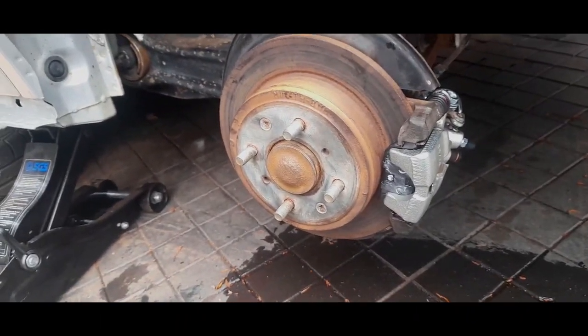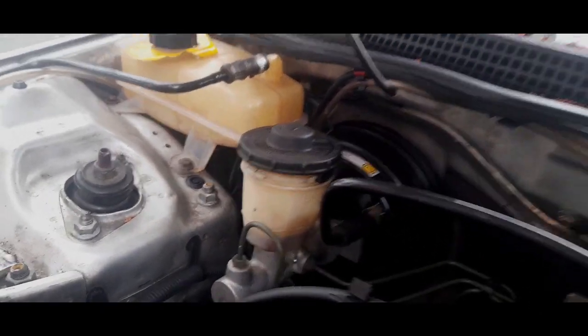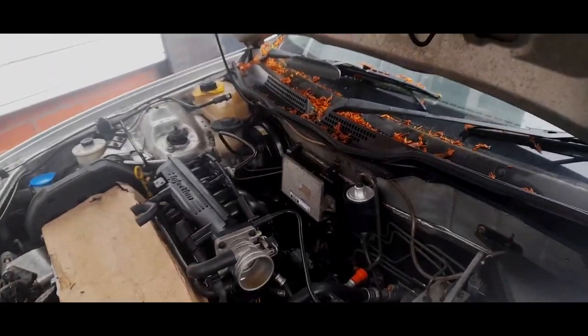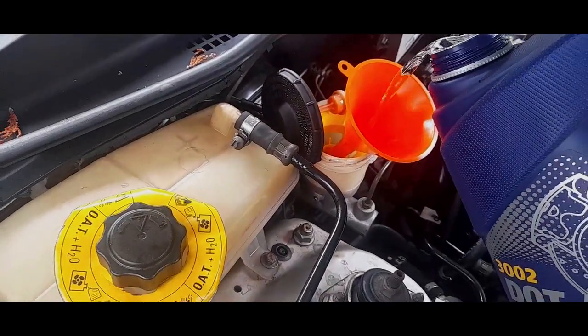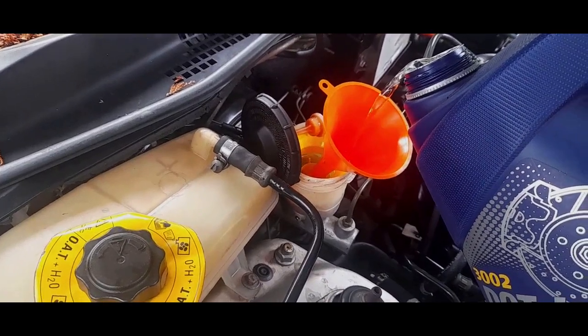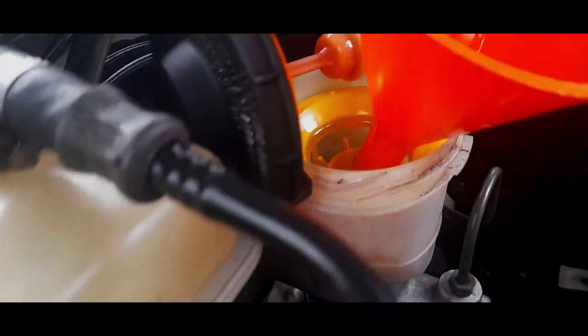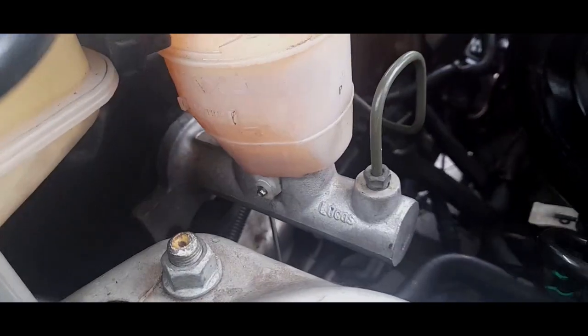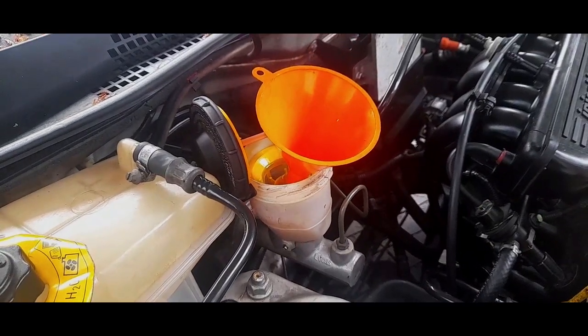Now the stage is you've got to depress the foot pedal several times. I'm aware the fluid at the front of the car is quite low - I'm going to top that up before we start. Careful not to spill this because it's quite toxic. I'm just going to fill it up very generously. See the colour of that fluid - it's almost transparent. What's down there is very different. Right, we're going to depress the pedal to set the pistons out.